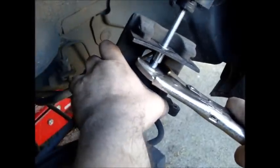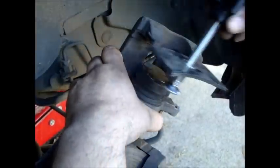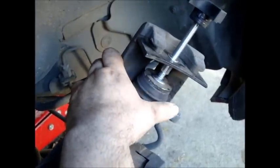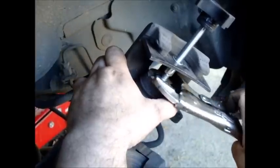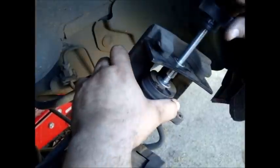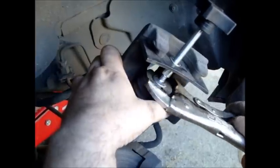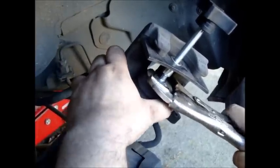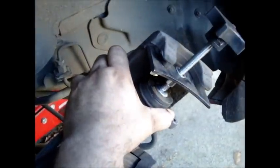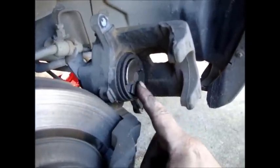The formula that works well for me is what I call one-to-one. You turn it, and once you break it loose you turn the vice grips once, then you turn the compressor tool once. This is going to take some time, but it seems to be pretty effective to get the job done. As you can see, the caliper is finally pushed all the way back down.